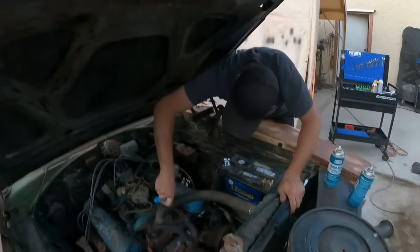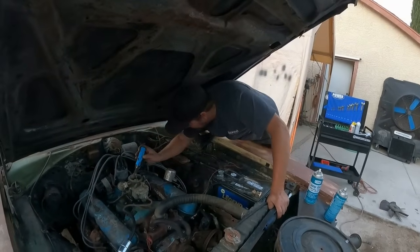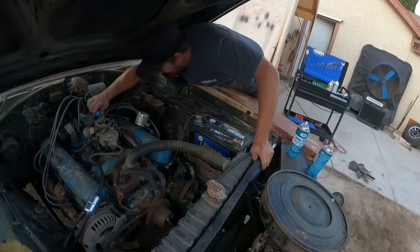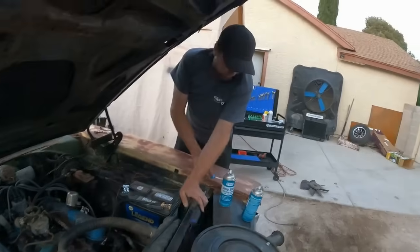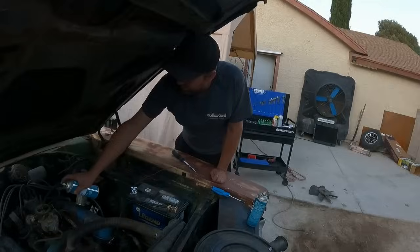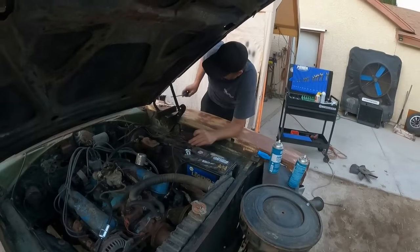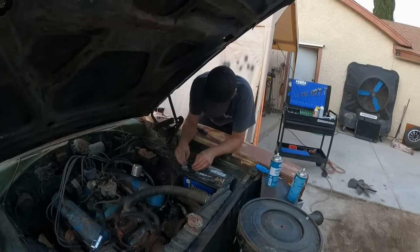All right, this carburetor, I'm positive needs rebuilt, but we're just gonna go ahead and roll with it. Raise the idle a little bit. It's hard to get a screwdriver in there. All right, Derek. Spray some juice in there. Ready? Let's see what happened. It's been sitting since 1984. Here's the coil wire. Shove it in the battery terminal.